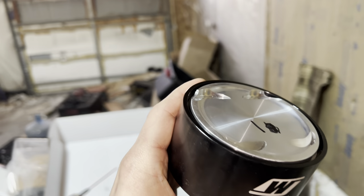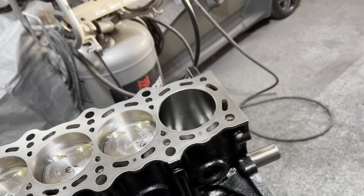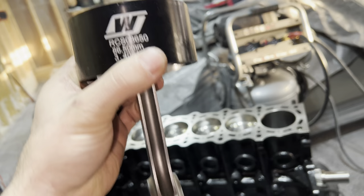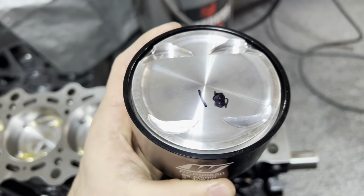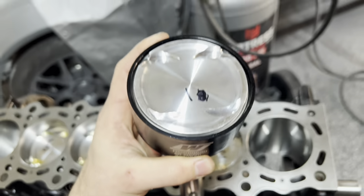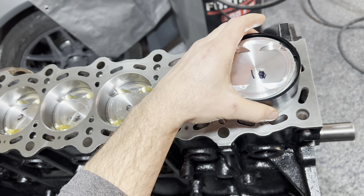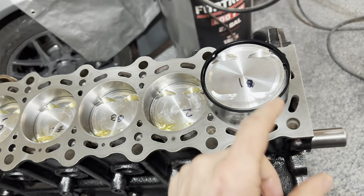Once you're here, we got it in the ring compressor. Make sure there's oil in the cylinder, make sure the cylinder is clean, make sure you've got lube on the bottom — I'm going to smear that in right before I set it down. Keep in mind bigger valves need to go towards the side that has the bigger valves, which is intake. You're going to take this very carefully and wiggle it around so it can find its little groove, just like so. We got it right there — it's all lubed up, cylinder's lubed up.